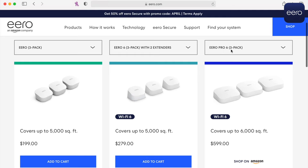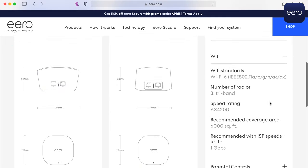My maximum internet speed is 117 megabits per second. With two Eero Pro 6 nodes, I was able to max out that speed basically anywhere inside my house. Eero Pro 6 has an AX4200 rating, which means it's capable of more than a gigabit per second internet speed. But that's just not a realistic number when connected wirelessly in a mesh setup. You will get gigabit speeds when your device is plugged directly into the Eero, assuming you pay for gigabit speeds.